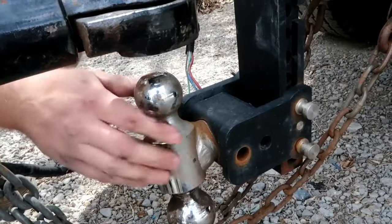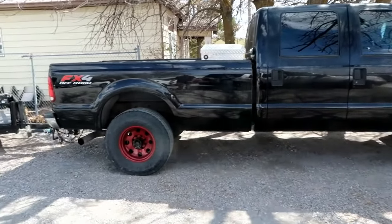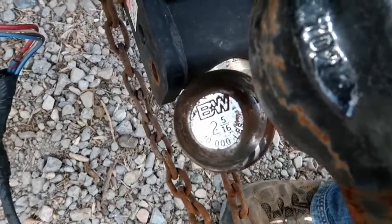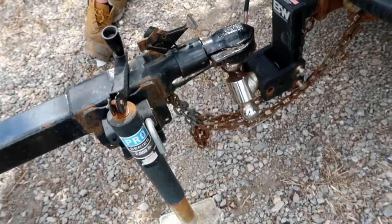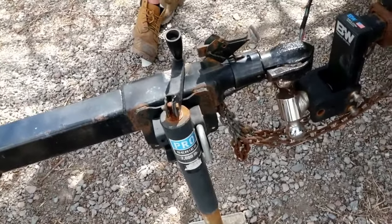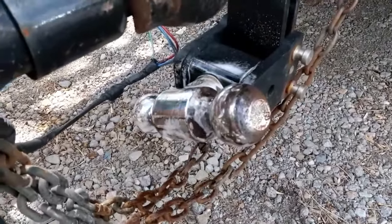You're not doing up and down with it very much? Nope. This height is perfectly level on my trailer, and I think I've got one more hole at the bottom. My truck isn't tall but it's taller than most. I've been happy with it. This ball is rated for 10,000 pounds. The other one I was towing with was rated for 7,500 pounds. When I'm towing, I might only have 6,000 pounds on the trailer, but when I'm hitting bumps or have to stop hard, there's more force being applied. So it's better to err on the side of safety — if it's a 7,000 pound trailer, 7,100 is probably barely enough. I was always wondering, is the ball going to bust while I'm driving?